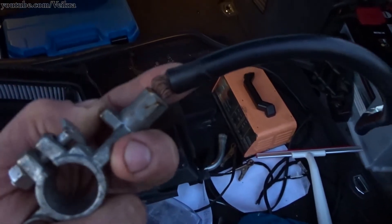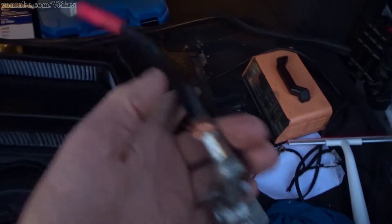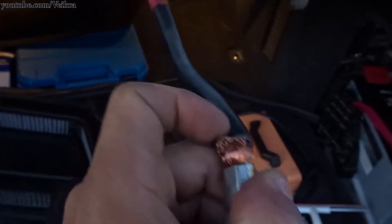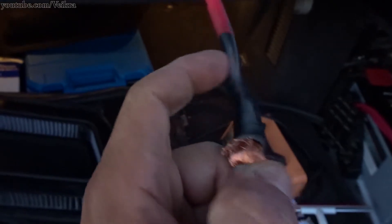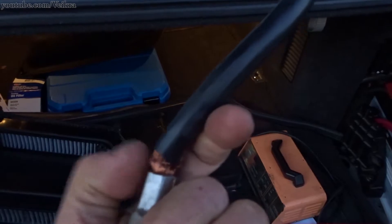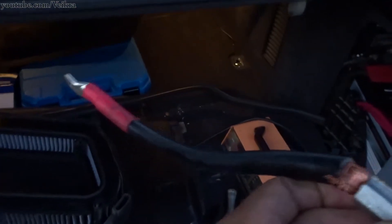It's very bad, really. And on that side, not as bad, but you can tell — I just moved them away — that a lot of the strands have broken free. And no doubt there are other broken strands inside of here. This is the main cable that goes to the front of the car, so that's no good. Eventually I'll buy a new one, but for now these work and they eliminate the problem.